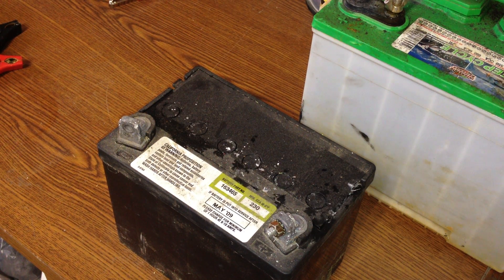Since I've got plenty of batteries to play with and I carry generators with me when I drive, I don't have to worry about a dead battery — I can always recharge on the go from a pull-start generator. I'm thinking of adding the Epsom salt magnesium sulfate solution to that battery, and seeing if doing that will prolong its current life rather than bringing it back. If it's at about 675–680 cranking amps, I'll see how long it continues to stay there. If I can make it another year without it going down, I've found a way to prolong the battery's life — maybe keeping sulfate from building up before it even starts.